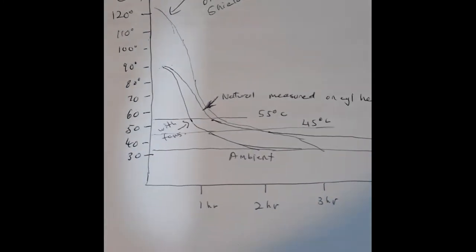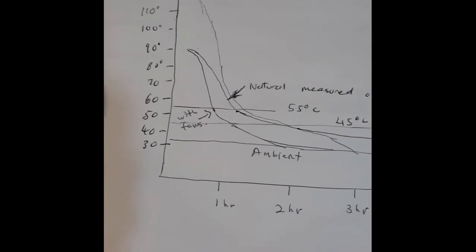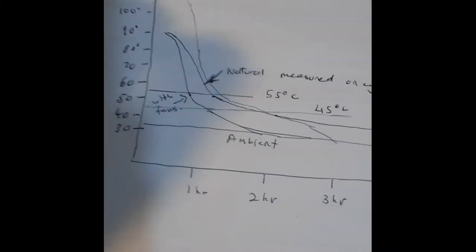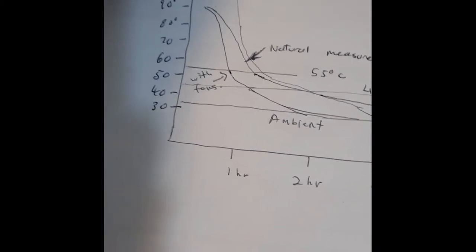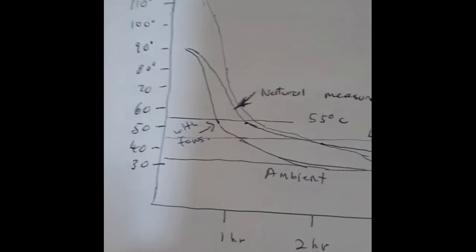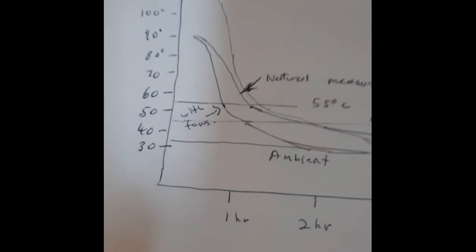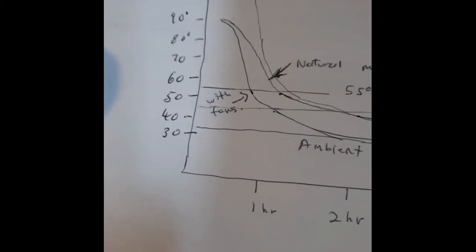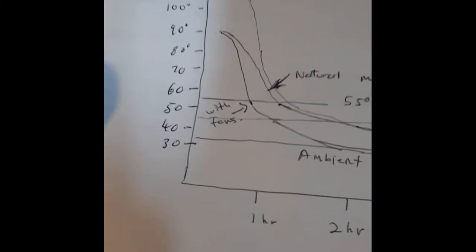Okay, here I'm going to explain why I chose a certain temperature to cut off the fans, and also why I changed the location. Initially, if you look at the earlier parts of the video, I said I wanted to measure on the turbo shield. What happened was, upon shutting down the engine, the turbo shield temperature was about 90 something Celsius, and upon shutting down, the temperature went up very quickly to over 120 Celsius within a minute. The problem is that the temperature sensor I bought cannot work beyond 120 degrees Celsius. The system will stay on, but it will not activate the relay. It will show an error, and even though the temperature drops below 120, it will not turn on the relay. So this is a flaw with the system.